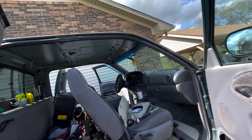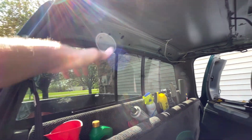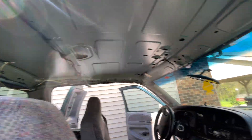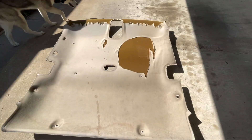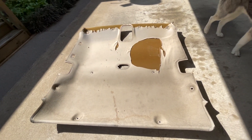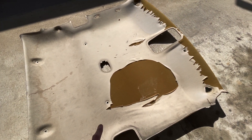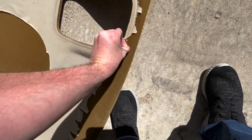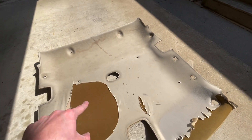See, most of the time when they build vehicles — I've talked to a lot of people — it's actually before they put the back window in that they slide it through. Makes it a whole lot easier. But once you clear everything you can see how that looks. The headliner's out. So what we're going to do now — you can see a little bit of the adhesive there, there's not much adhesive on this at all. We're going to come to the spots where it's coming off and start taking all the old stuff off. We want absolutely every bit of this old headliner off this foam pad.